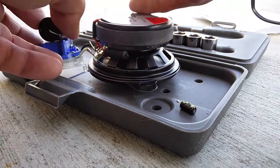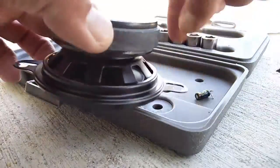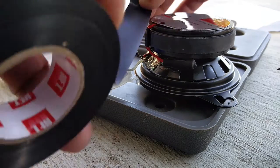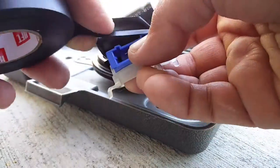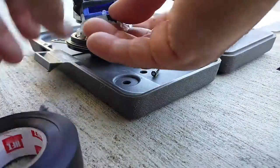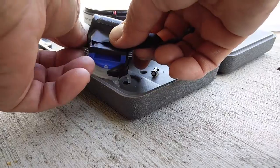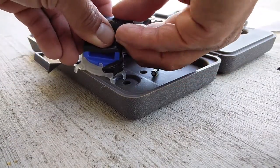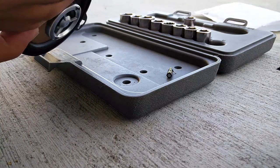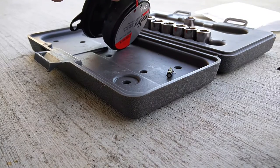Now I'm soldering it back onto the stock connector. After doing this mod and installing it back in the Prius, I definitely had better sound and better bass response in the car — it made a big difference. I also did some peel and seal into the door panels which I believe helped as well. Now I've got it all done and soldered. You're going to want to do that for both the left and right. Since some of the wires for that capacitor are exposed, I wrapped it up with electrical tape. Of course you don't want to cover up the port connector. Then I folded the capacitor back down so it's more streamlined.